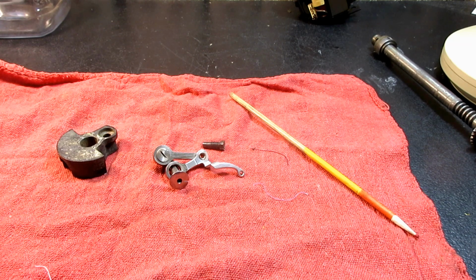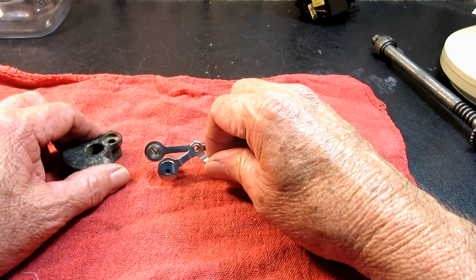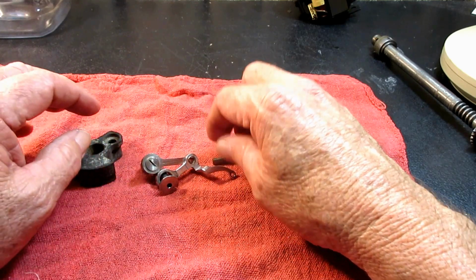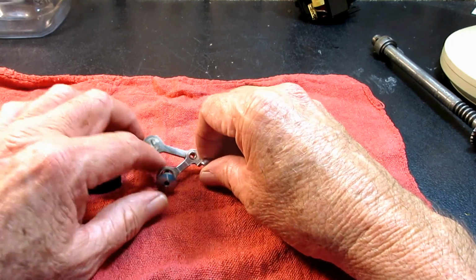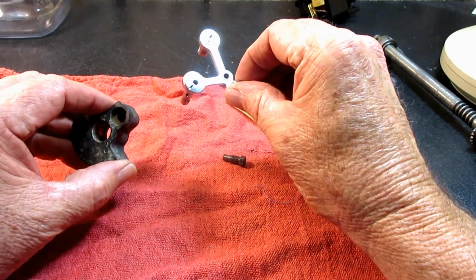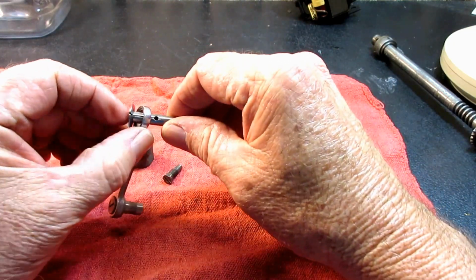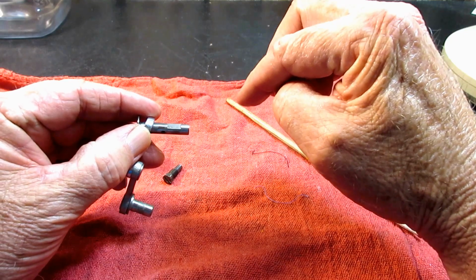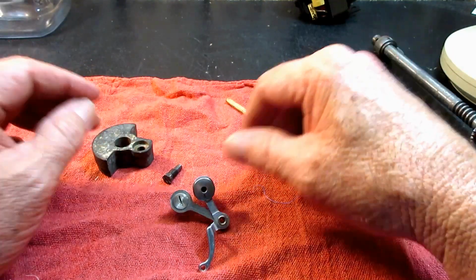Looping underneath is normally caused by not enough or poor upper tension. That's very true. And looping on the top would normally mean too much upper tension. A small percentage of the time the tension on the bobbin case is wrong. And now I know that at least once, if you screw up putting that set screw on the flat spot, you've got a super low percentage of the looping cause, but you did it yourself.